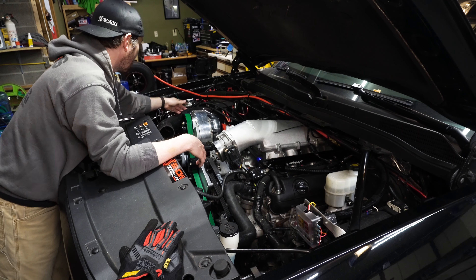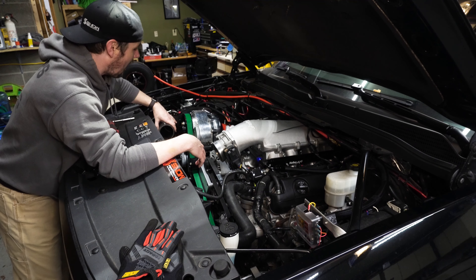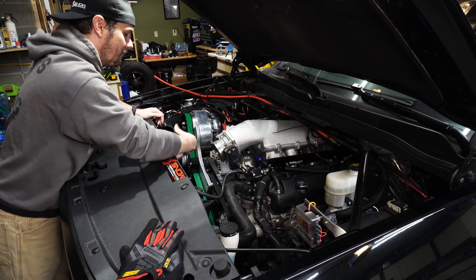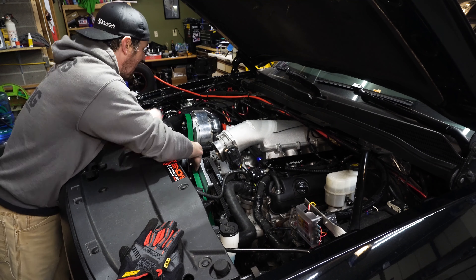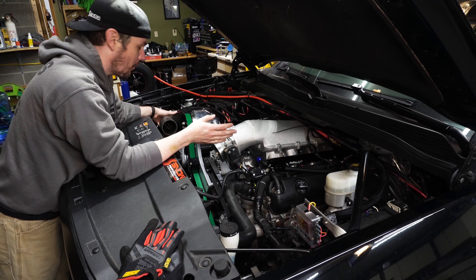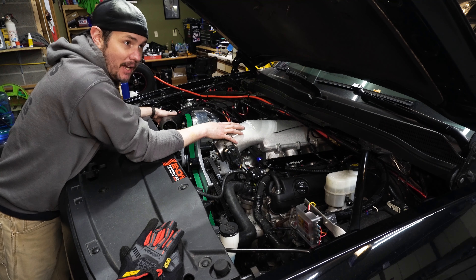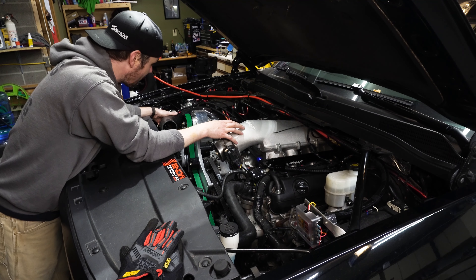This green wire that's hanging out is for our boost controller, because now our bypass valve is over here above our snow performance methanol pump. I'm also waiting on a 90-degree fitting straight out of here. I've always used a reducer off the throttle body — this is an LT4 throttle body from Solar Performance — and then had a pipe 90 come in. With the radiator being here everything gets a little tight, so I want a 90 straight out. For now, we're not running an intercooler. We're going to be using the snow performance methanol injection kit to do chemical intercooling. We'll keep an eye on the IATs, and I may have an air-to-water heat exchanger somewhere that I need to figure out how to mount.